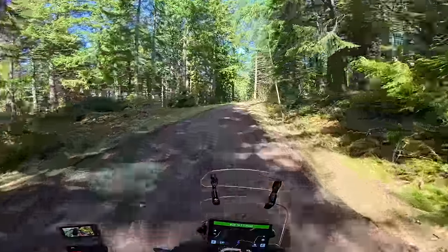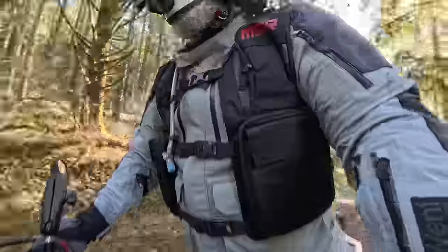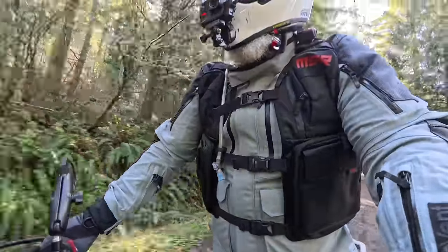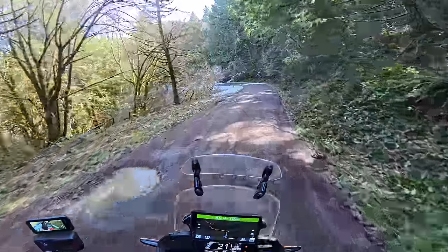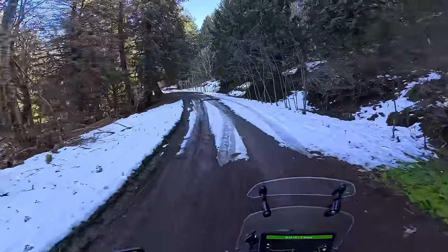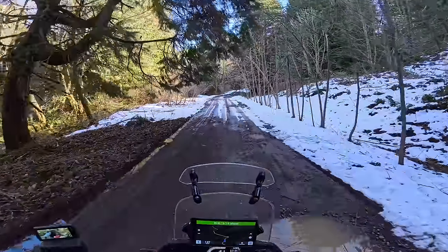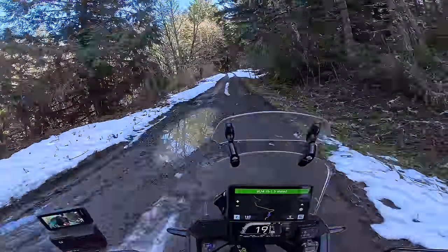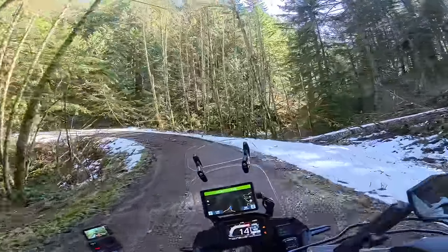Yeah, this is much more comparable to the 790. I mean, based on the little bit of time I have on it. Still not adjustable, so it's set up for me, but the only adjustment I have is preload front and rear, which is fine for adjusting for luggage and stuff, but not gonna give you the fine tuning adjustability to, one, set it up for you specifically, and two, adapt to changing terrain necessarily. See what I said I was gonna not do with the snow, and here we are doing the snow. Yeah, that's the big thing, it's not bottoming to where I feel like it's rebounding so hard that I don't have any traction.